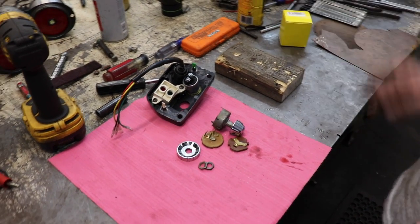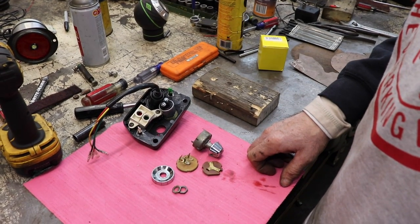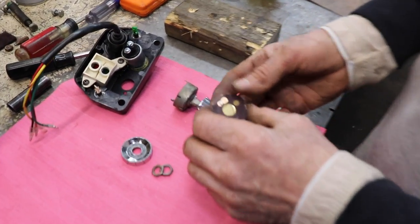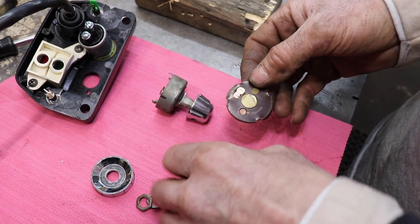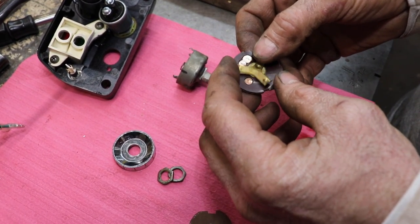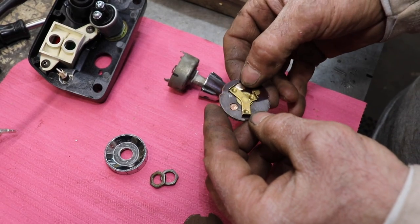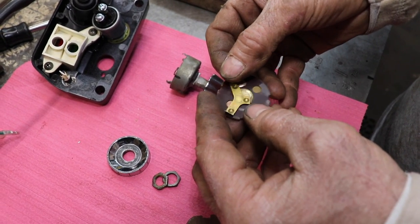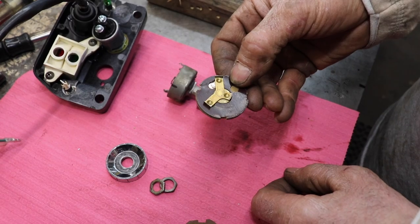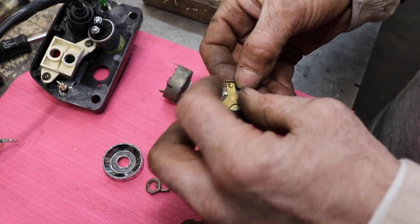It wasn't that much. So I took the old blower switch apart and said, I'm going to make that into a headlight switch. And I did. I had to add a contact to it, because this is how this works. This is off, and this is the first position, which would be the parking lights. And then by adding that little contact, soldering it to that one, when I turn it to here, it connects all of them together, and that'll be parking lights and headlights. Whereas before, it just was activating that, and when you turned it here, it activated the other terminal.